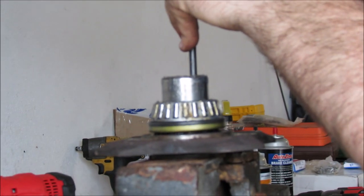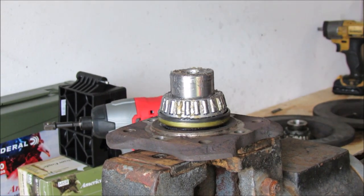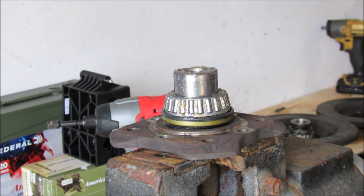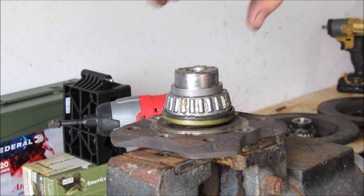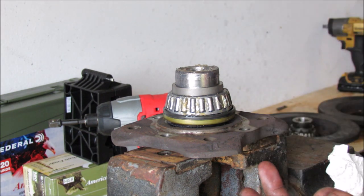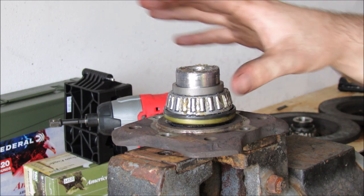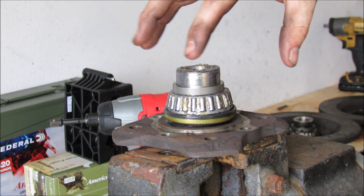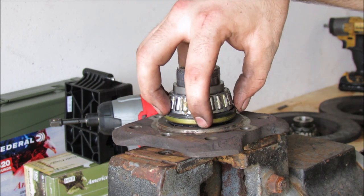See how it's solid sounding now? She's seated — it's as far as she's going. When you're drifting it on, you'll be able to hear the difference in sound once it seats. Make sure you go four corners and make sure it's seated level properly. Then put your spacer on — this is very important. It spaces out the spindle, this half to the other half, and makes sure everything is in alignment. Then put a little dab of grease on the rubber seal here so that when you press the other side on, it just slides right over instead of snagging and damaging parts.